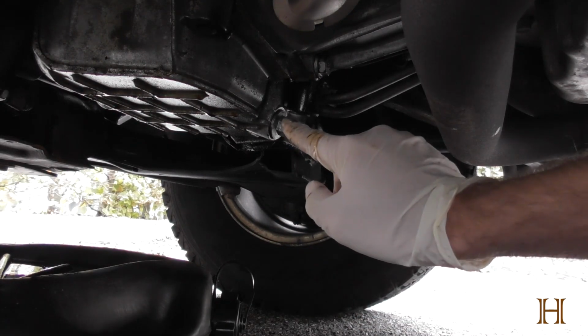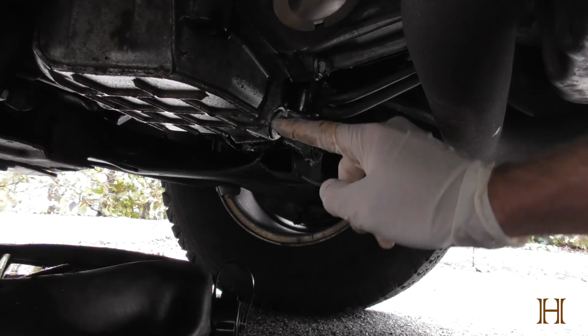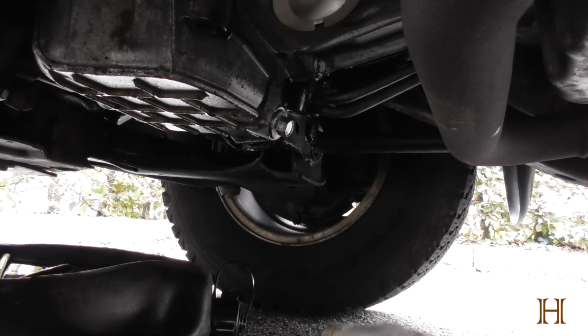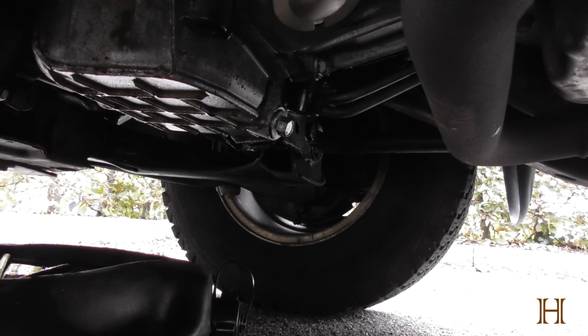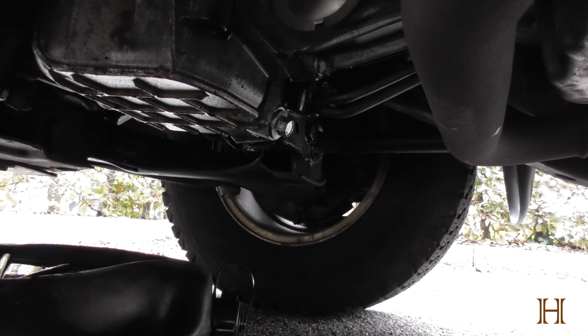These drain plugs, they will break off if you put too much force on it. Then you'll have the plug inside, the head off. You have to take it to the shop, then they'll have to drill it out and tap a new hole, or change the whole oil pan if you're unlucky. So since that's good, afterwards, once we fire it up, we'll take some brake clean, spray everything down, make sure everything's nice and clean, wipe this off. This is good. Now we're going to go up front to where the oil filter is and remove that.